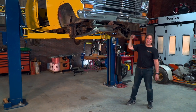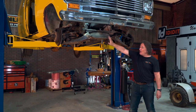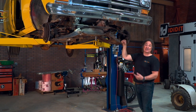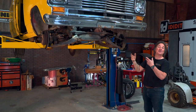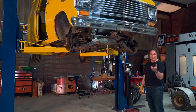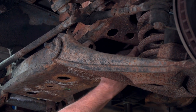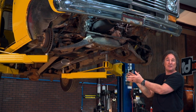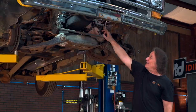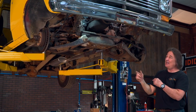Back underneath - the reason we haven't started replacing all of this suspension stuff is because we've got to go a lot deeper if we're going to do an engine swap. That cross member has to be dealt with, the engine mounts, and ultimately that engine have got to come out. There are a couple of ways to pull an engine out of a van: you can take it out the front, which is a tight fit, or you can drop everything out the bottom, which is what GM did. You unbolt the cross member from the frame and drop the cross member, engine, and everything down as one big package. Obviously you're going to need a lift, but either way, the goal is to get this engine out and swap out these engine mounts with those from a V8, then start fitting the new engine.